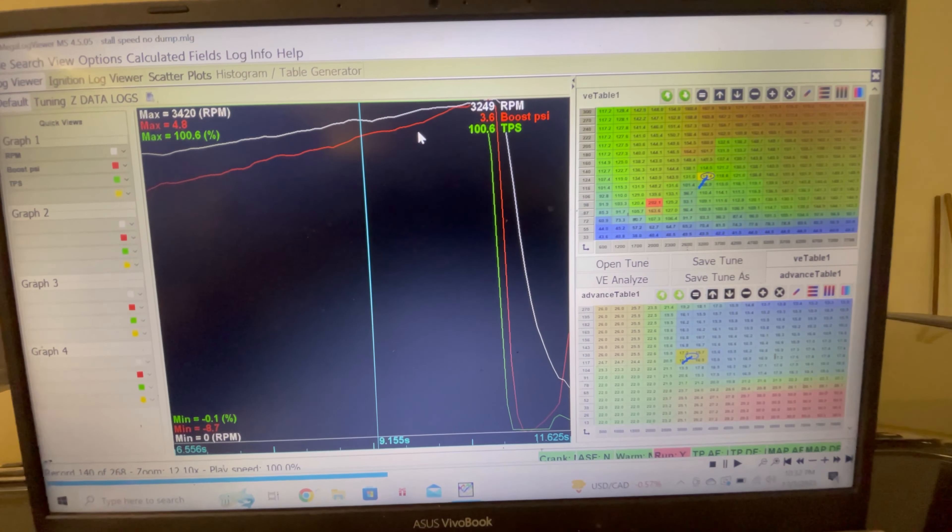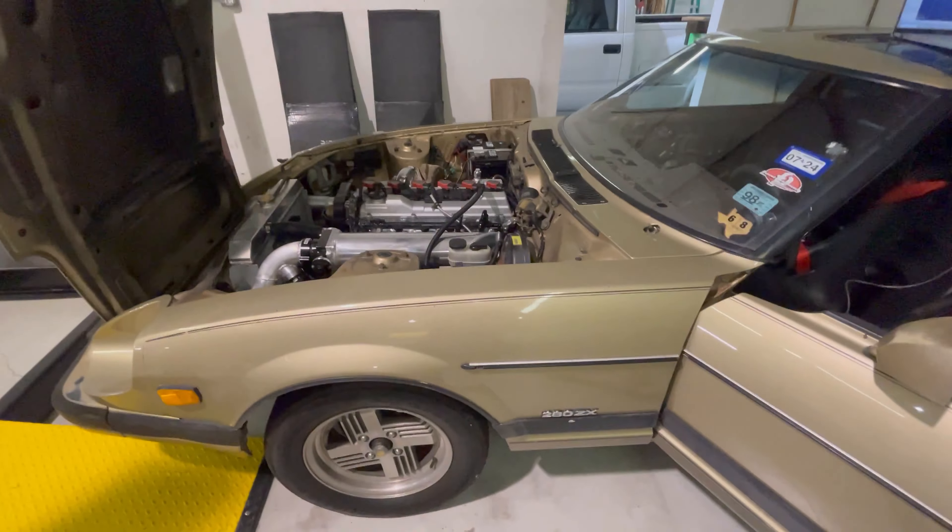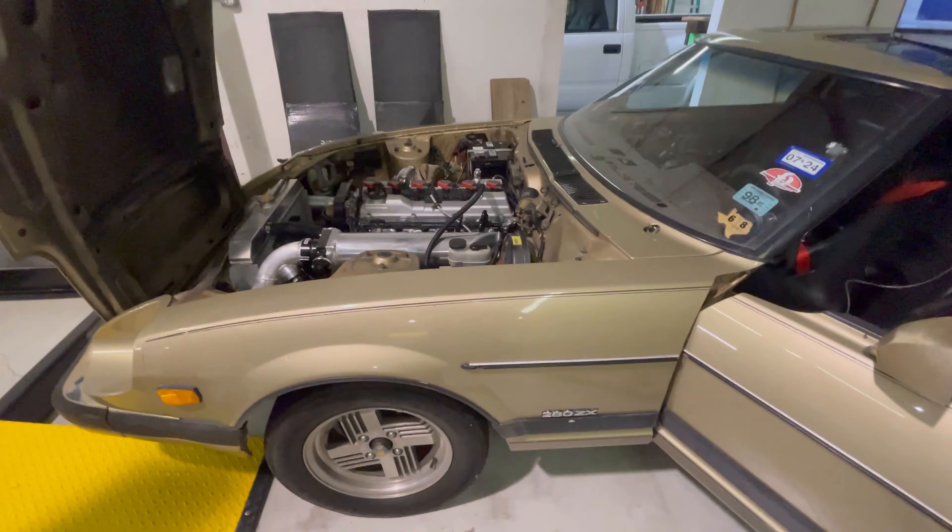Tomorrow Saturday I'm putting new front tires on the car — these front tires are a little old and starting to dry rot. I went through and put little zip ties on all of my vacuum hoses. I've never really had a problem with vacuum hoses just popping off, but it's free insurance — the last thing you want is to be chasing some weird running problem at the track because a vacuum hose popped off. It's a common race car trick. I'm just stoked — this car is ready to rip. It's ripping on wastegate boost and I might turn it up a tiny bit. Next time you see me, we're going to be at IFO.